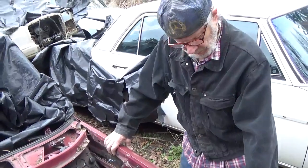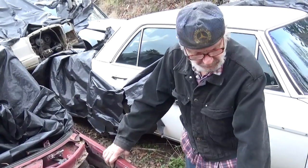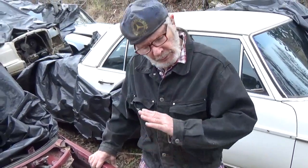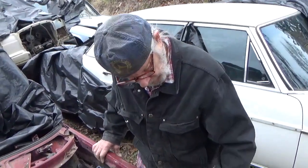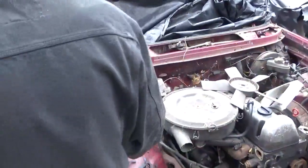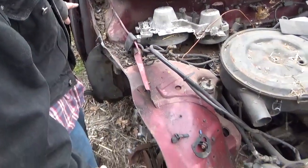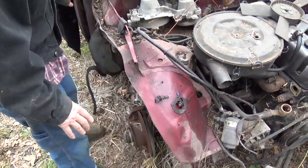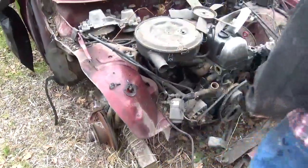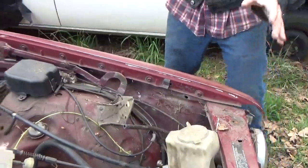Then you're ready for your replacement fender. Now if you're getting a fender off somebody's parts car, you want to do it similarly. Here's what I've done on this side to remove the fender for a customer — since I'm not saving this car body, I cut with a sawzall along the inner fender panel right along in here to get the fender off.